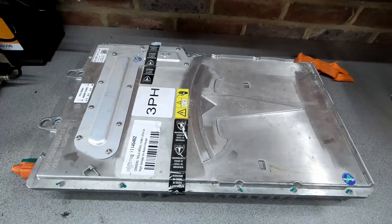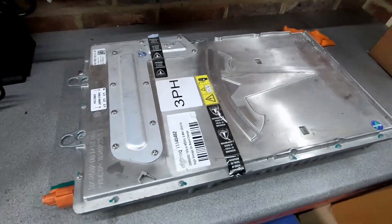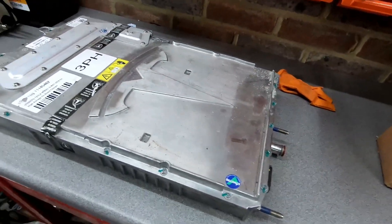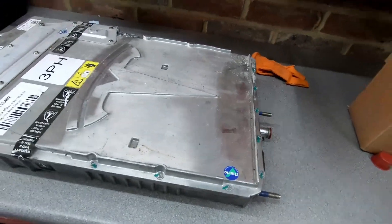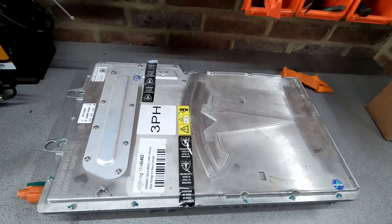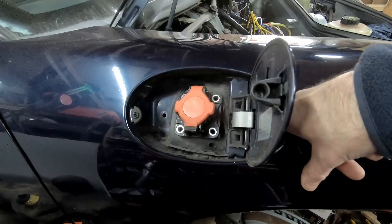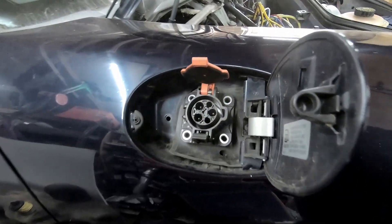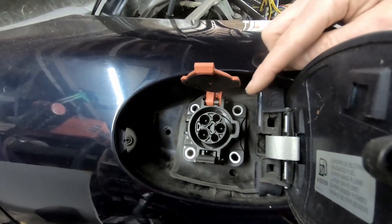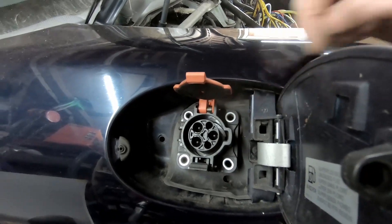Here's what we're planning to put in the front of the car — getting the big T in there, finally getting some Tesla components in to go with the Leaf components and various other manufacturers. This is going to go in the front where the fuel tank was. It is a Tesla third-generation battery charger, three-phase, up to 22 kilowatts. We're going to get that working on open-source software and firmware, and get the components needed to get power through it. As a sneak peek — I know this is a Type 1 charge port and won't be able to use all the power the Tesla charger can provide, but it came with the Leaf stack I bought. So I'm going to get it installed, use it to start with, and get a Type 2 charger at some point in the future.